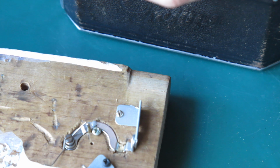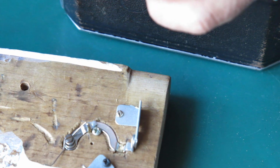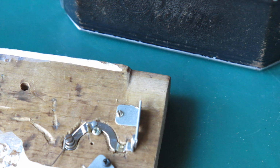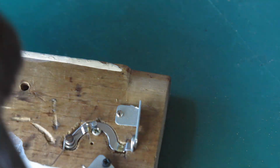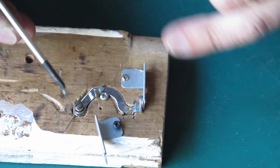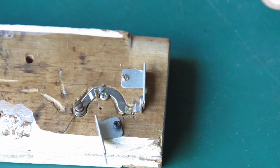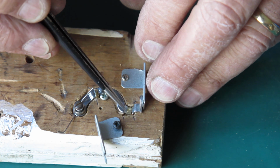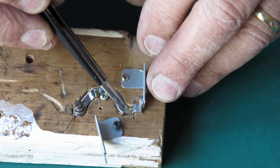And I've got a body here, a 142 body. That makes that to be considerably less, about 2 millimeters. So I think I need to bring in my two ends closer together, which doesn't surprise me greatly because I was generous in allowing metal either end.